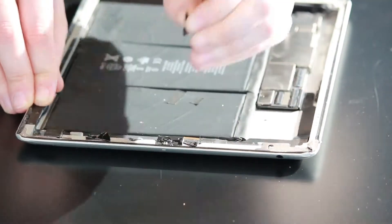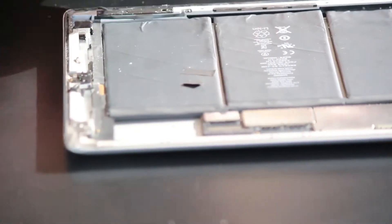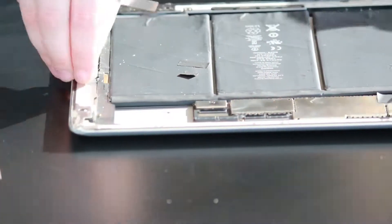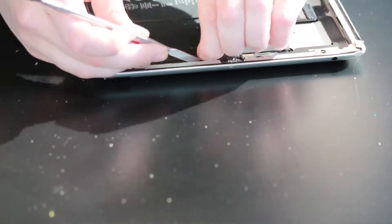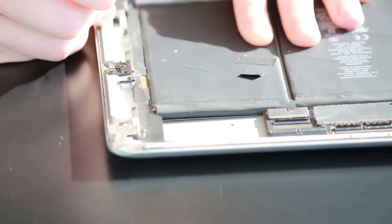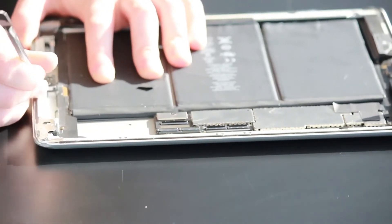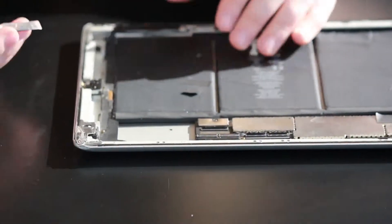Now go around the frame of the iPad and take off all the extra glass and adhesive stuck on there so the new glass can sit on it and adhere properly. Use the metal spudger to twist off as much of the glass as possible, then scrape off any excess adhesive. Also knock out any glass chunks and dust — always keep your area clean because it's easy to scratch things or get broken glass in your hand. I also noticed the frame is extremely dented, so I'm going to walk you through how to deal with a dented frame as well.